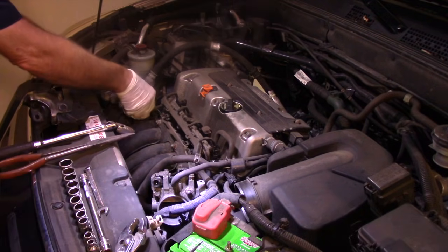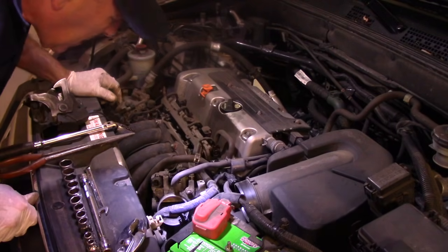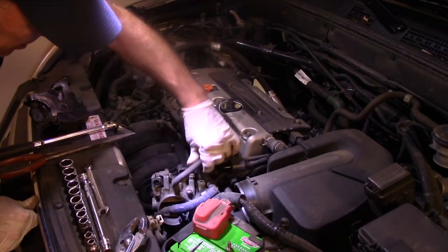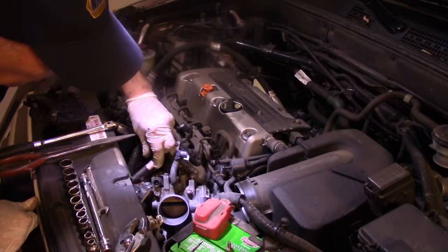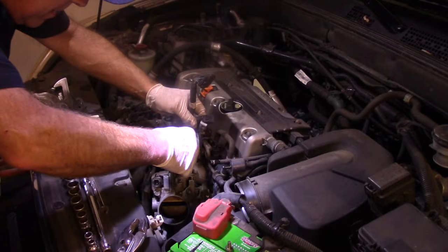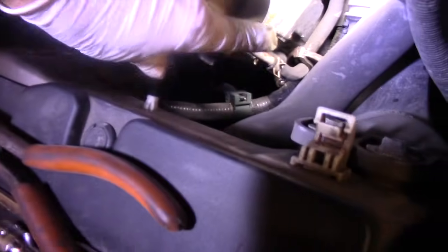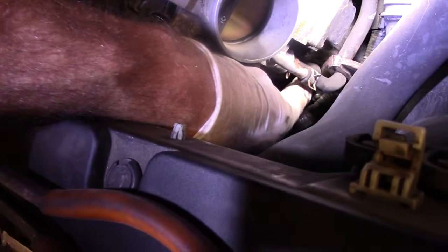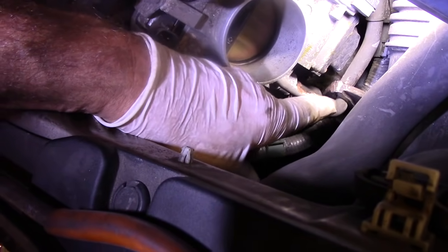This one probably doesn't have to move, but I'm going to get it out of the way anyway. Now we have everything just about disconnected. We need to take off those two lines on the bottom that carry the coolant. I just want to show you where those hoses are located — down here you can see one right here and the other is back over there. I put vice grips on them to try to minimize the amount of fluid loss, so I just pinched off these lines very, very loosely. Now we're going to disconnect these two.